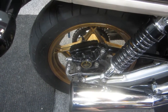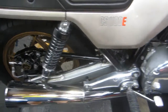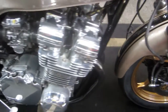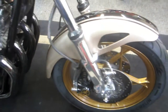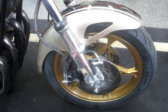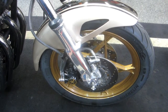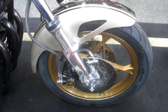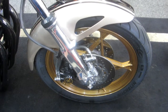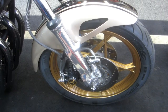If you know your pads are worn out - I remember one friend's Ducati where the back pad was worn right into the metal and was actually dangerous; the back wasn't even a usable brake at that point. Luciano and I straightened it out, but it could be dangerous. Brake pads are relatively cheap, so don't compromise - get real EBC pads, or OEM from the factory, or Brembo if you want to spend extra money.